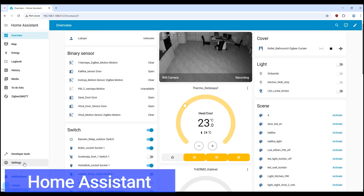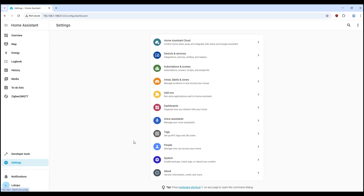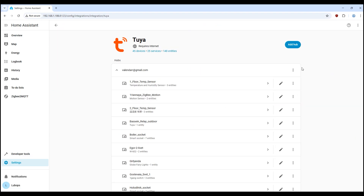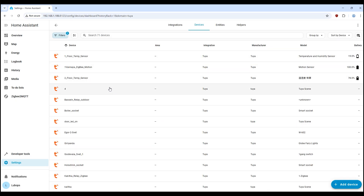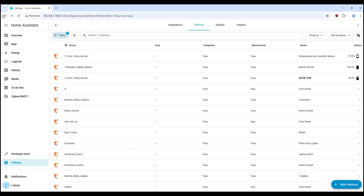Let's test what the device can do in the Home Assistant smart home ecosystem. We'll check the integration via the Tuya cloud server. We go to our integrations and restart our Tuya integration. After that, we go to Devices and find our detector — Smart Wi-Fi Smoke Detector. The sensor is currently clear; if there is smoke, the status will change. Diagnostic information shows battery at 69%, battery state showing 'low' for some reason, and smoke amount at 1.4 ppm. History is kept for both the device and the sensor. Logbook is present. We can use automations, scenes, and scripts, and add our sensor and diagnostic information to the dashboard. This Wi-Fi device works through the Tuya integration, which requires the internet, but the detector is fully supported by Home Assistant.